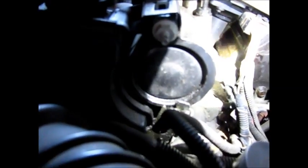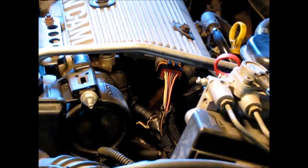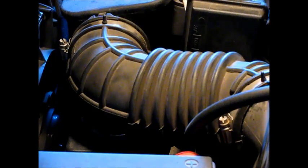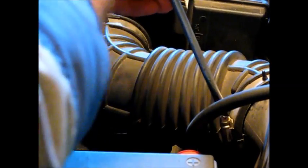What we're going to do here is unplug this connector here, unplug another connector underneath it, and then remove this air inlet hose so we can have a better look underneath there. Let's get some of this wiring out of the way — here's one plug, this one goes to the spark plugs. Another one that's in the way is right here between the banks, so we'll get that out of the way. We also need to get this air duct out of the way because it's blocking our view and ability to see what's going on down there at that water outlet.